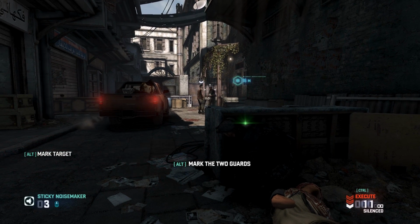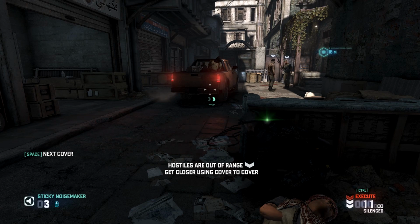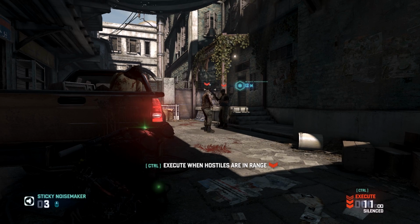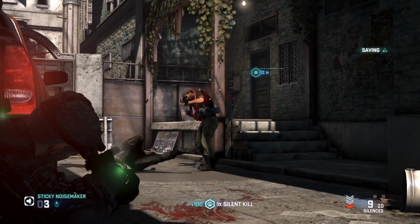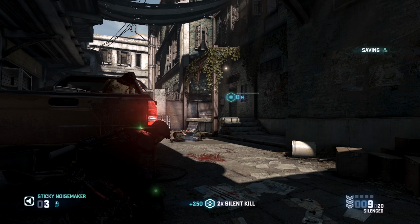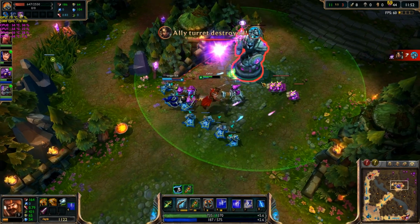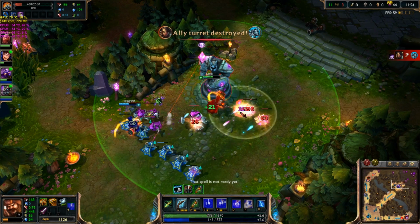And what we saw overall was for the CPU, of course, depending on the actual load, would really vary. You're going to be looking at anywhere from between, let's say, the mid 40s all the way up to maybe close to a little bit over 70 C in the most demanding scenarios that you would have. In terms of the GPU, once again, it also depends on what you're going to be doing with the GPU, but under the most demanding game scenarios, we saw just about the same temperatures that you would see in a traditional ATX system, which is quite impressive. Overall, you were seeing generally between about your mid 60s for less demanding games, to the most demanding games being somewhere between about your mid 70s to a little bit over about 80 C, about 82, 83 C in terms of those temperatures.